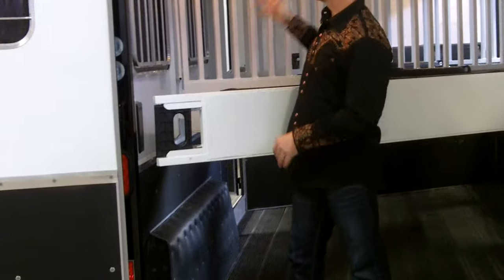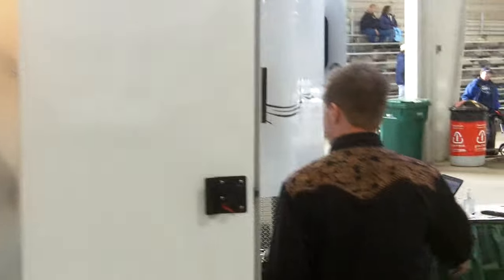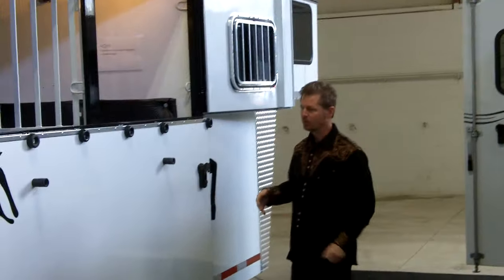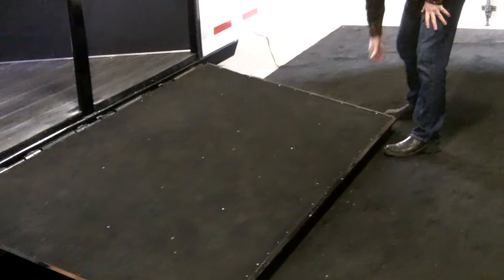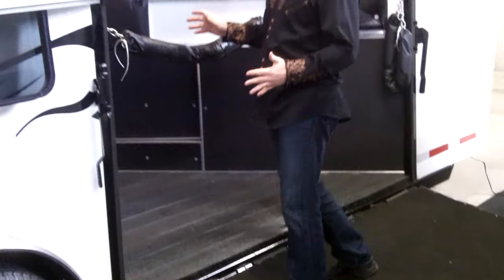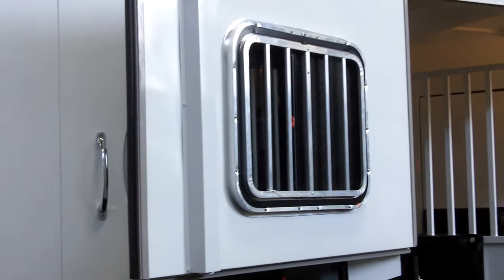So if you were unloading in a rear-facing design, your horses would already be unloaded — you just pull the partition and there's plenty of space to unload the guys. Now let's walk around to the side. This is a really cool feature. Of course we do have drop-down windows on both sides, so if you're forward-facing or rear, there's always a drop at the horse's head. This is a double side ramp and it just goes down nice and soft — very easy to maneuver even with the size of the ramp. On these stalls, the conventional horse stall is normally 40 inches in width. I've made these particular ones about 48 to 50 inches on the front and on the center, with the top doors folded out of the way.